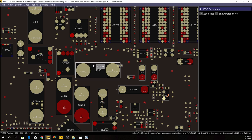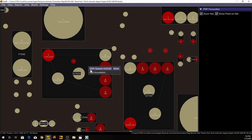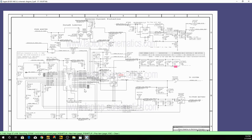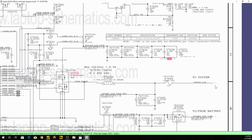Let's pull up a board view and see what those components actually are for, and if those are actually for PP bus. Here is our FET that looks screwed up, and that was clicking. All the pins that look messed up were ground. Most likely they didn't have a very good hot air station when it was replaced. It's Q7030, and this is going to be for our ISL — I mean for PP bus generation. We see it goes through L7030, which is our inductor, F7040 which is our fuse, and the outcome is PP bus G3 hot.